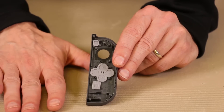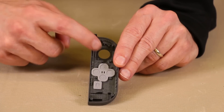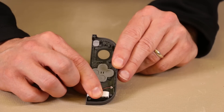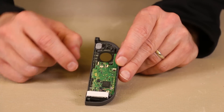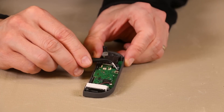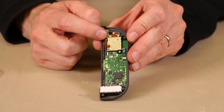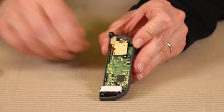Now it's time to reinstall all the parts into our Joy-Con controller. We have all the buttons in. We always want to make sure that the button pads are all the way down how they should be and that the buttons are fully inserted into their grooves. Then we'll install the vibration motor — push down firmly to make sure that it gets stuck back in place — and then we install the motherboard and the two screws. Now that the motherboard is installed, we install our analog stick. Now it's time to reinsert our buttons in the top. After the Phillips screws are installed, we do need to install the ribbon cable into its connector and then lock down the locking tab.